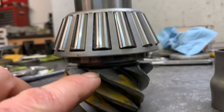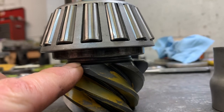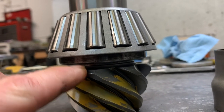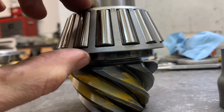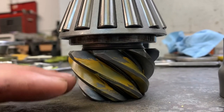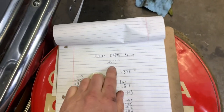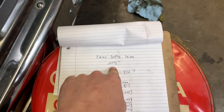There is a shim right there — you can see it's like a little flat washer right there. That's because this bearing sits in the housing in a fixed position, and this shim is adjustable, pushing the pinion closer or further away from the ring gear.